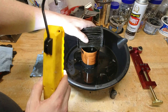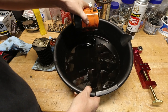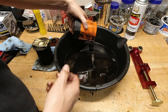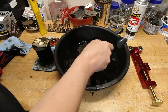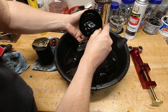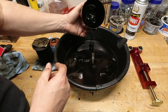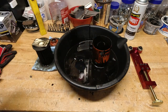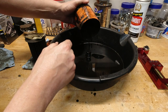I'll dump the remaining oil back over the magnet to see if I can pull anything out of it. This one has some crusty nasty stuff in it. The magnet has attracted quite a bit of material — don't let that fool you, because if you attract a lot of gunk there is probably some metal material in there. Look at the bottom of the filter: it's just a big gooey nasty mess of garbage. To do a better inspection, feel the magnet and see if there's any texture beyond the gummy nastiness — and this one certainly has a little bit to it.